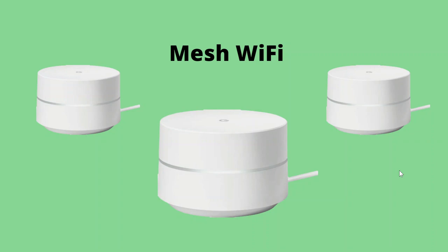The final word on Wi-Fi performance is mesh. Someday all home networks may be mesh networks. Most mesh systems are extremely easy to set up and provide excellent Wi-Fi performance in homes up to and sometimes exceeding 5,000 square feet, with intuitive smartphone interfaces for setup and configuration. One of the greatest features of mesh is seamless roaming — even with multiple access points throughout your home, you don't have to disconnect and reconnect as you move between them. The only downside is cost, but even that's coming down. You'll find a link below for a top-performing mesh system for under $200.